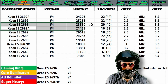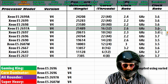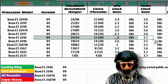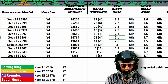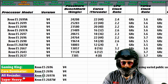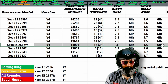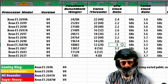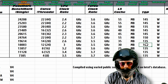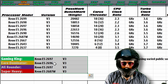The all-rounder has to be the 2697 or maybe the 2697A — a couple of core difference between them. They are really good in terms of their boost clock speed, so ideal maybe for video games if you're going that direction on your system. Another CPU to keep an eye out for is the E5-2687W, which is a very powerful CPU with a decent clock speed. But that one does use quite a bit of power, so stay cautious — it might use too much power for your liking.